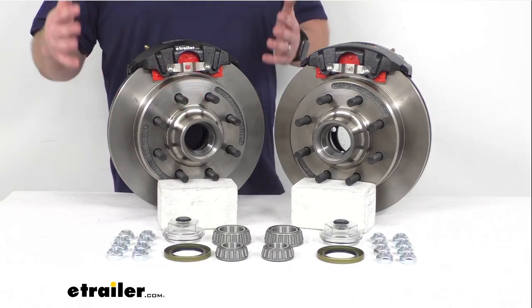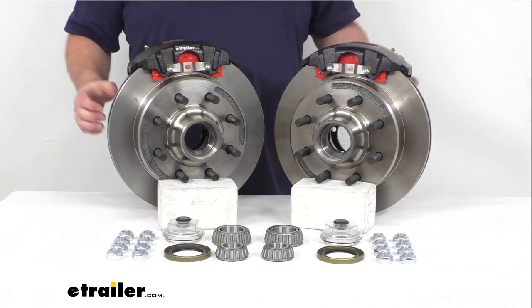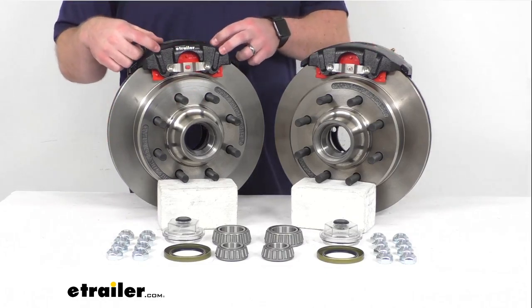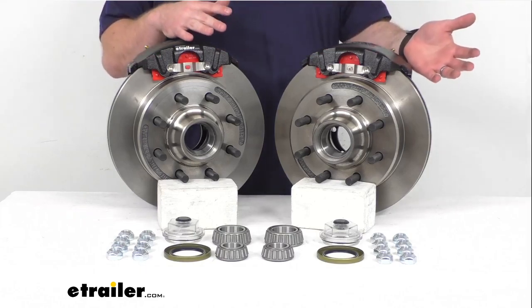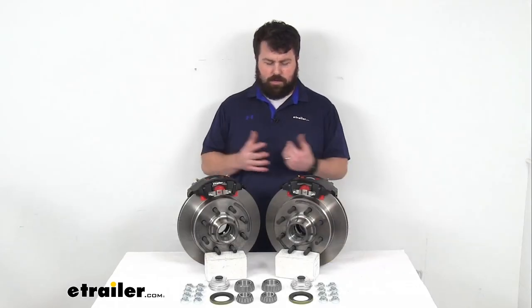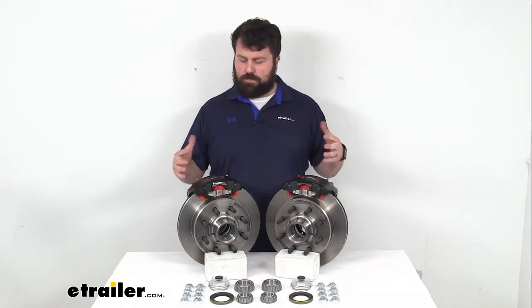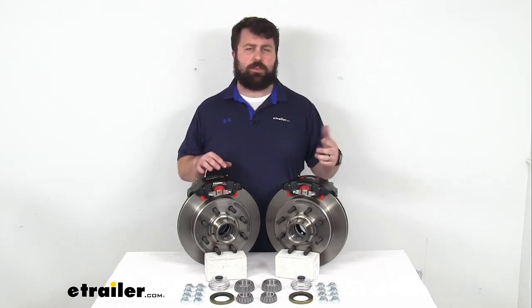These will work for your wheels that are 16 inches and larger. Our calipers and our caliper mounting brackets both have an e-coat that's going to help resist rust and corrosion with a 250 to 350 hour salt spray rating. So these are going to provide adequate rust protection for your campers, car haulers, or utility type trailers.